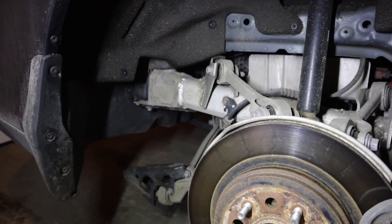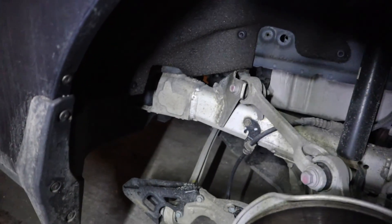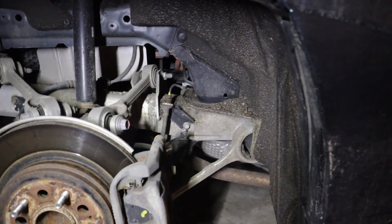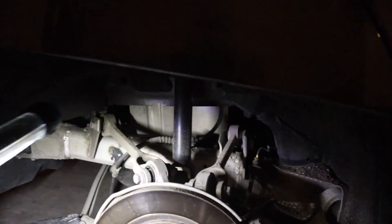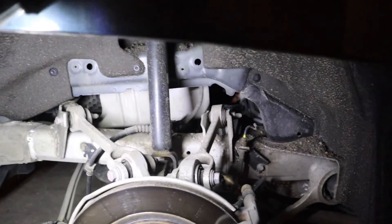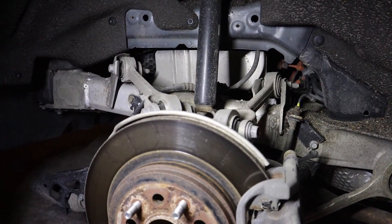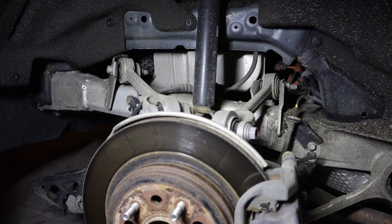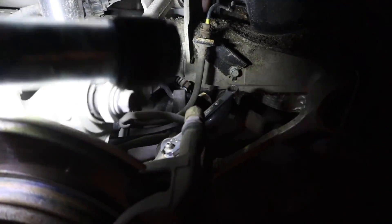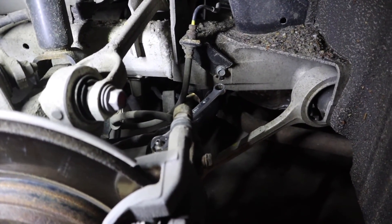At the right rear wheel, I've taken off the little dust cap off the bleed nipple. Get a load of this rear suspension — look at all that linkage! One bushing, two bushing, one, two, three, four, five. The car clearly rides really well and all this trickery is because that looks an awful lot like the battery back there. Wrinkle number two: there's the bleed screw, and I need a wrench on it — it's an 11mm. Of course I have 10 and 12, so luckily a seven-sixteenths will fit on that.